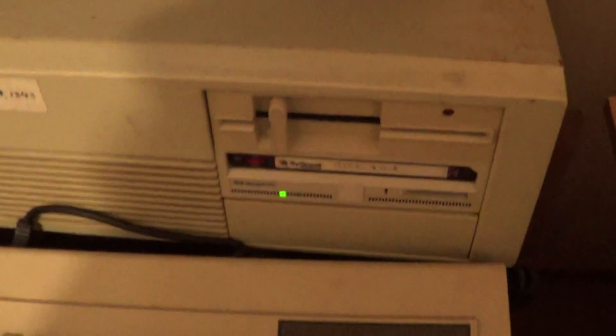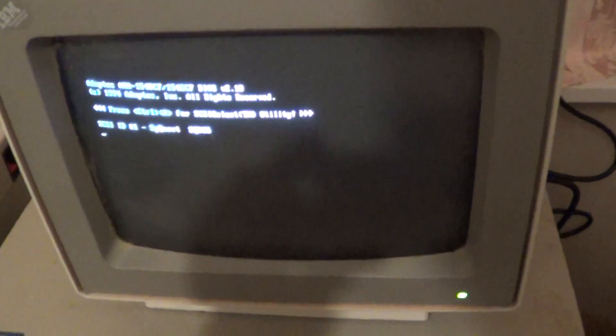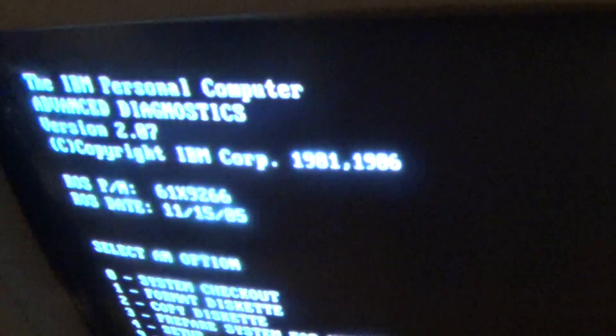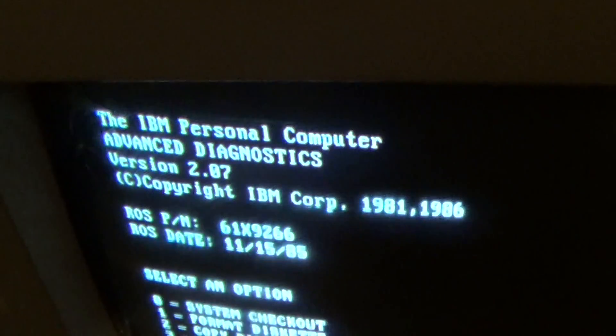I've actually got a copy of the original AT Diagnostics. Rebooting is a bit tricky because I have my fake Model F AT clone keyboard and it doesn't have the layout to do Control-Alt-Delete with one hand. What was also awesome about this machine is I used my original OEM MS-DOS 5 install discs — I just find it awesome to use original media. Here the monitor report is from the PS/2, and you can see it's identified the motherboard as a genuine IBM part. If you're not familiar with the 5170, you'll really want to make this disc because the tools on it are very useful — everything from low-level formatting and that sort of stuff.